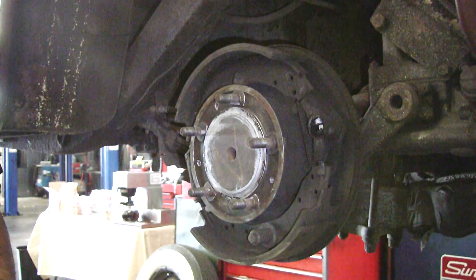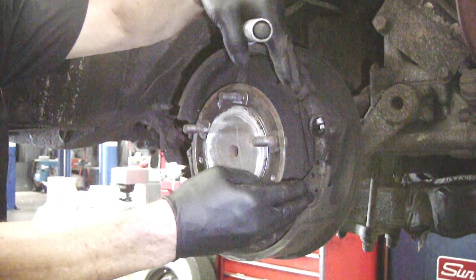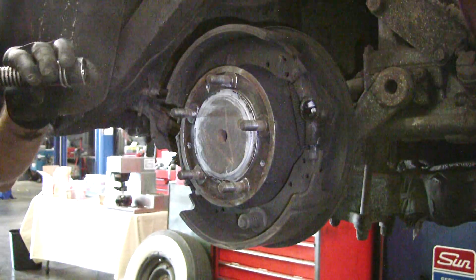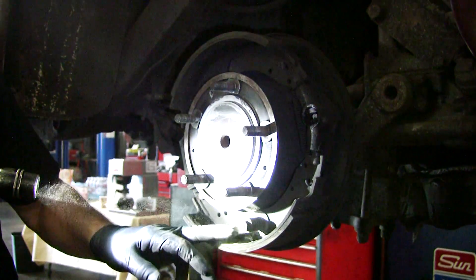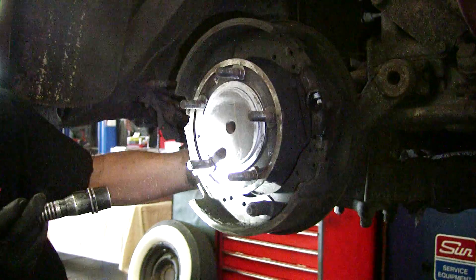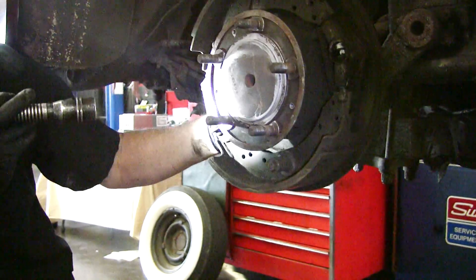You're saying the shoes will rotate back just a hair? Yeah. When you do this, it's going to spread here and slide these back. These float — this right up here has nothing to stop it, it floats totally. This one has — I don't know what they call that — a shake back. So that one should kind of stay in place. You can see it's right next to the bottom one, but not the top one. See the difference?